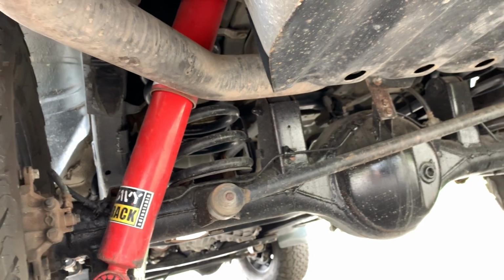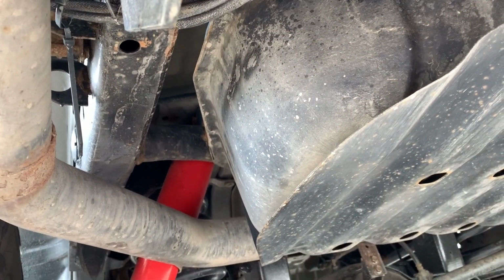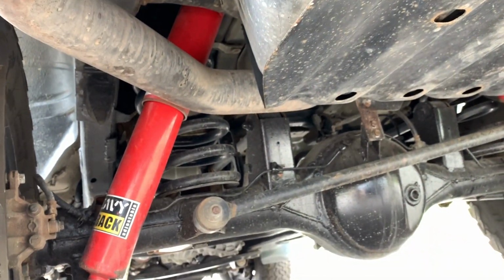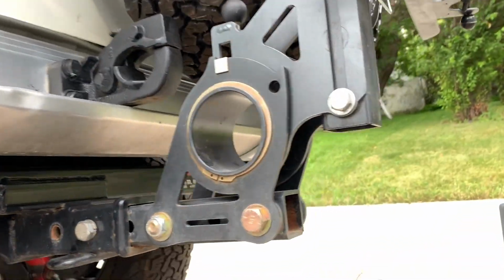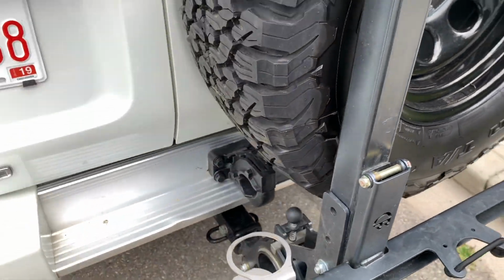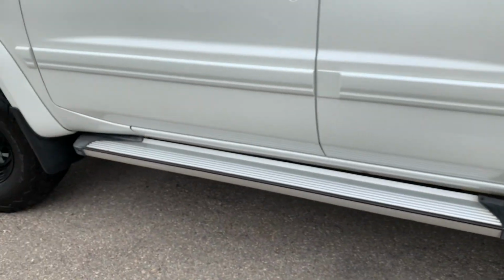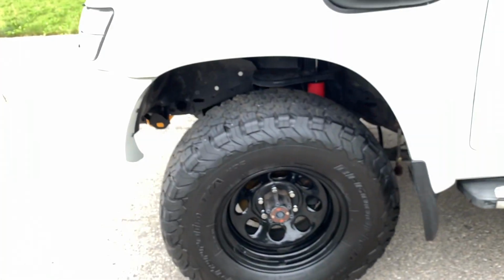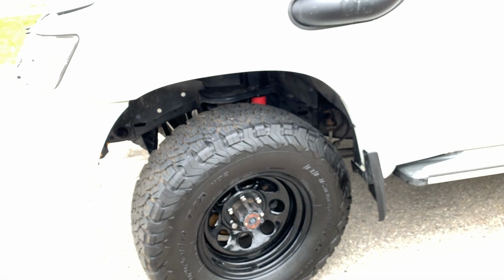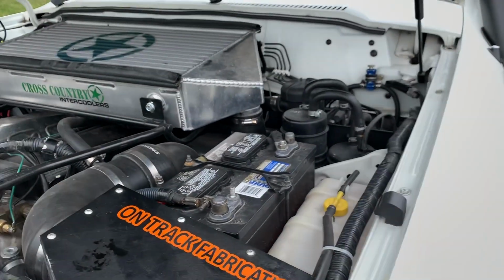Really, I want to take it off the road, bring it into a nice warm shop, put on an exhaust brake, again for towing, get the lockup for the torque converter if I have to, do a transmission rebuild. 4-inch BD exhaust brake that goes down to a 3.5, so it'll fit right in the exhaust, perfect, lots of area to install it.